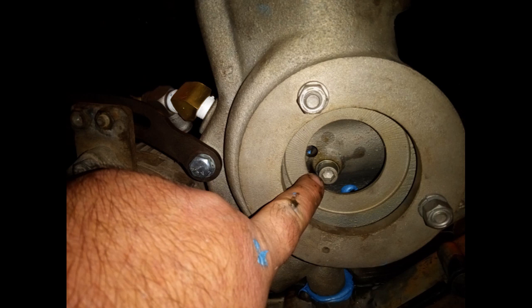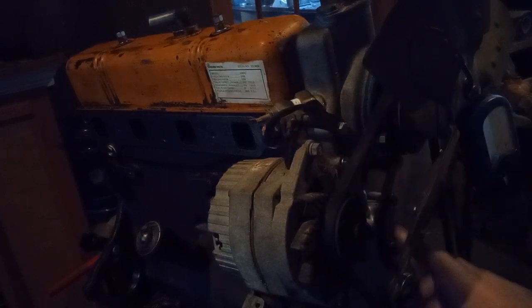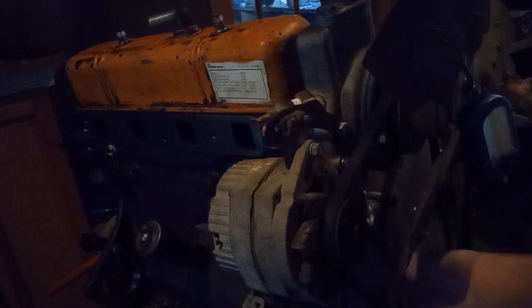Hey, potato nation. Water pump — I'll show a picture. The bolt in the center uses an allen wrench and needs to have Loctite. The reason for that is when your motor is moving around, it doesn't back out into the impeller, which is in here and spins. For your water pump bolts, don't forget to put your bracket on while you're putting the bolt on, before you torque them down.